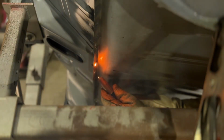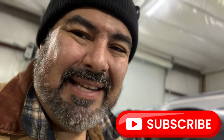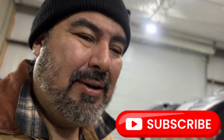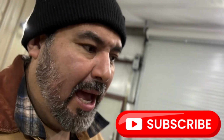And then I gotta make a piece for that right here where my finger's at, for that janky floor panel that they sold me, because it has big old gaps, which I'm not hating, because it did allow me to adjust it a little bit better. But kind of useless. Like, why the hole? I guess if you can't hammer and dolly that corner around, but why? Why do they put a slit with a big gap? All the rest of it wasn't done like that, and there were tight corners there. Anyways, I gotta make a piece to fill that little spot where they left it open on the aftermarket floor pan in the front.